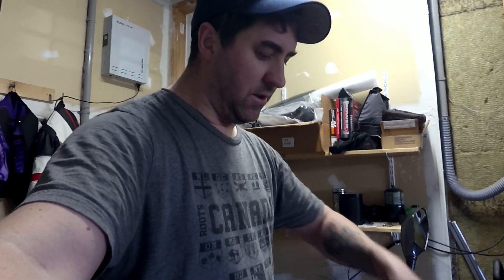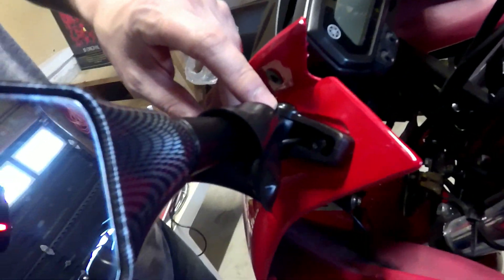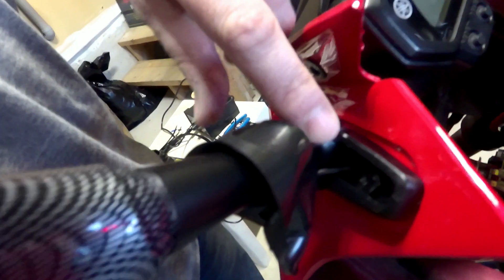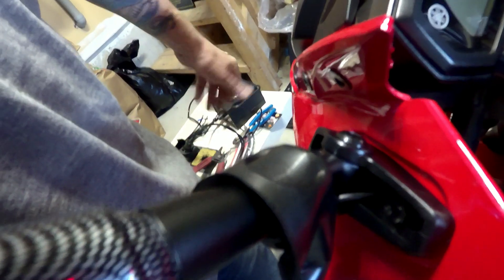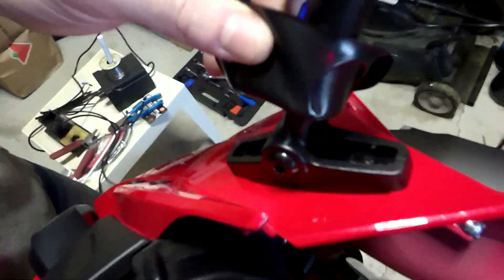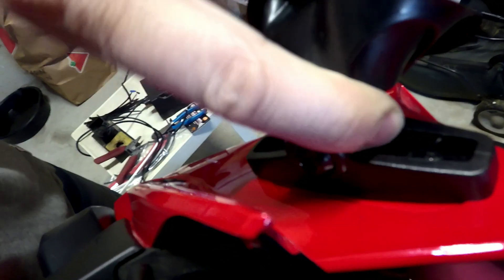In order to get your electrical wire down through into the bike, you actually have to drill down into your mirror mounts. I'll try to give you a close up here — hopefully you can see it. You can see the little wire there. I drilled a small — I think a 3/16th hole — down inside the mirror mounts, and again over on this side you can see the wire there.